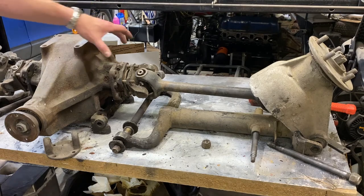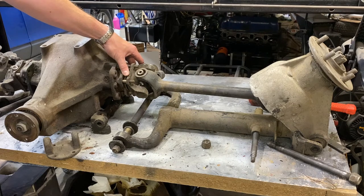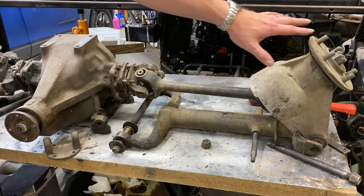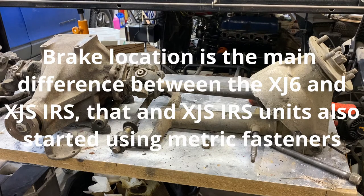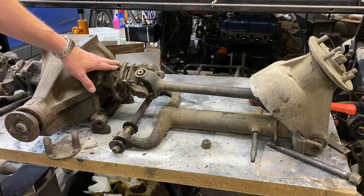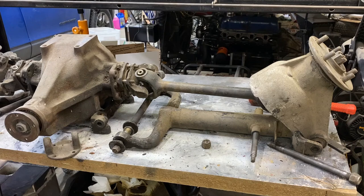On this end, this is where your brakes would go if you choose to do inboard brakes. If you want to do externally mounted brakes, later model XJSs have a hub that has the brakes on the outside. It's better for handling to have the brakes inboard because that gives you less unsprung weight, but they're a little harder to work on — so that's why with later models they went to hub-mounted brakes.